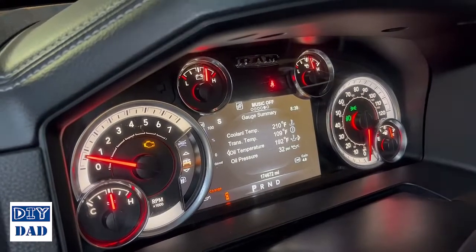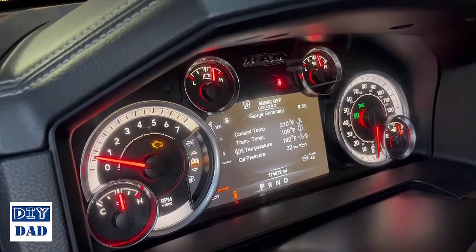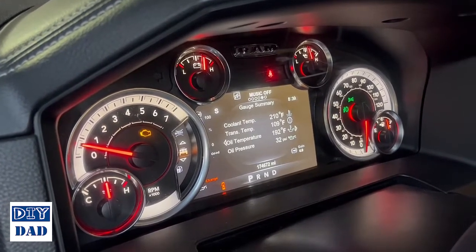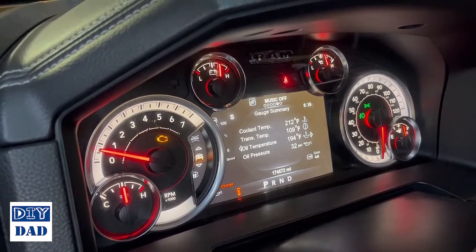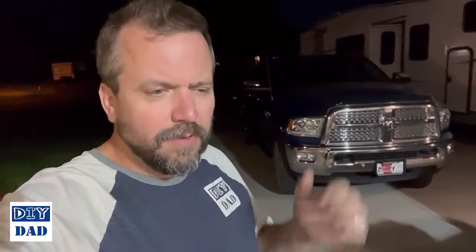Back in the truck — I haven't cleared the check engine light yet because I just did this repair, but something I'm happy to see is my coolant temp currently reading at 210 degrees. Prior to this repair it never went over 185. You can see it's fluctuating, going up and back down — the system is opening and closing the thermostat the way it should. I'm going to get the code cleared off the dash and see if that's solved my irrational thermostat problem. After a test drive and clearing codes a few times, temperatures are now behaving correctly, going up to about 220 and then coming back down like a normal truck.